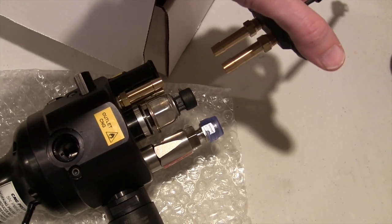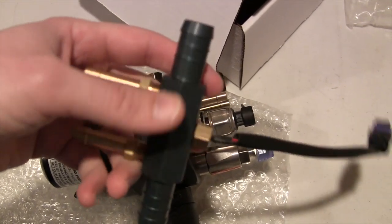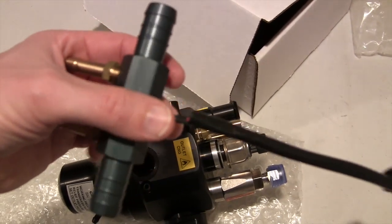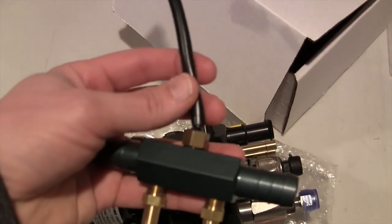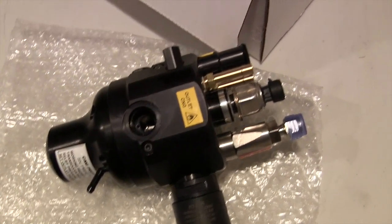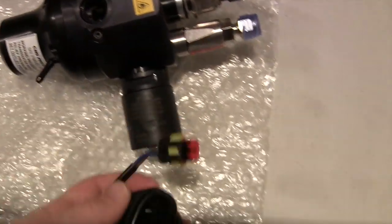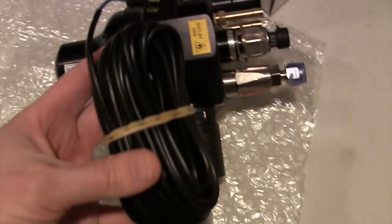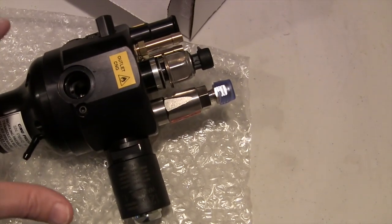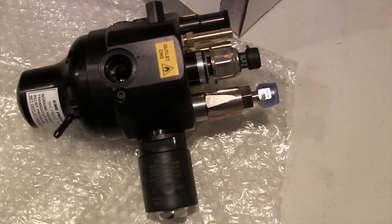The water temp connections — you'll have hoses that connect these two together; the water is going to go in and out. This green part will just tap in — you'll cut your hot water line and tap this in. This connects to the ECU for the CNG system; it's a temperature sensor to make sure that the water temperature is adequate. This line also comes with the reducer — it plugs into the solenoid and you run it to your controller, the ECU. Ours are typically set at the factory to go to a two bar outlet, which is about 30 psi.